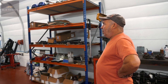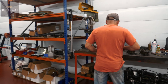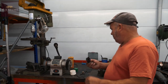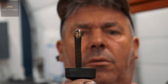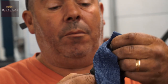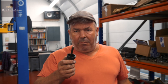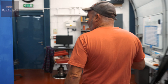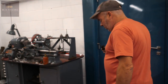Initially the clutch jammed up, and not knowing what it was, I went round to the guy's house. This was wedged in the gearbox — you can see that's been made, you can see the end of that has been welded. There was a bit missing off the clutch plate, and the thrust bearing has either caught or fallen off. I would say it's fallen off.